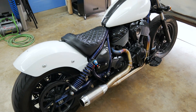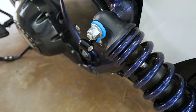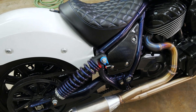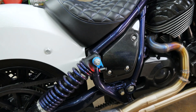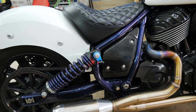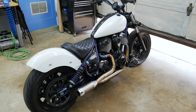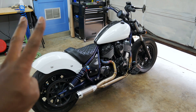That's my new license plate and signal light setup — very simple. I'll leave a link down to these little signal lights in the description. I printed these in PLA. Normally I would do PETG because PETG stands up to UV rays and temperature a lot more, but I'm not worried about heat on these, and if something happens I'll just print some more. I like the blue — it does stand out versus blending in with black or purple to match the bike. I like that it just stands out and you can see that something was custom done. The bike looks sick as it is. Let me know what y'all think down below. Thanks for watching — make sure you subscribe so you can see more about this bike, and I will catch you in the next one. Peace.